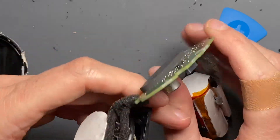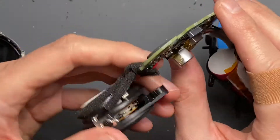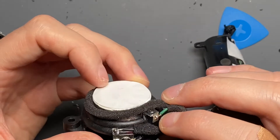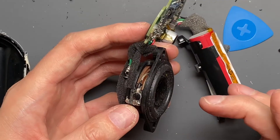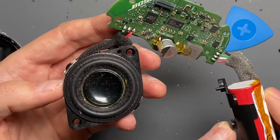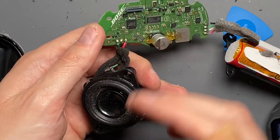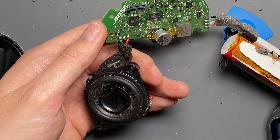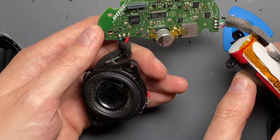The speaker has three wires going to it, and I think I know why. Bose has this clever thing where they're able to determine when the speaker is distorting. There's the negative and positive that go right into the spider, and then there's this green wire. I think it's related to detecting when the speaker cone bottoms out — like a feedback winding on a transformer that can detect what signal's going out and what the waveform looks like. If it's non-sinusoidal, it knows the speaker is being overdriven. It adapts the EQ to the speaker actively, which is awesome — minimizing distortion without requiring a super expensive speaker.